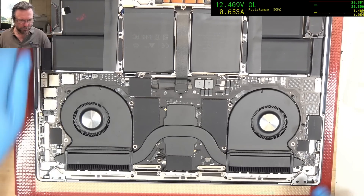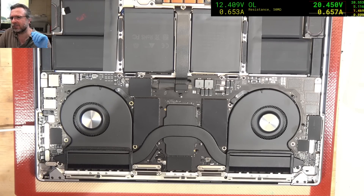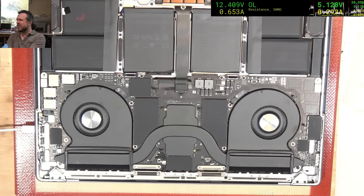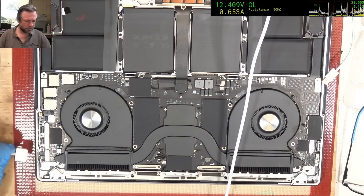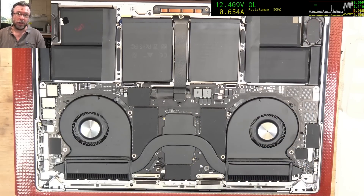Let's see if USB-C gives us anything interesting — 20 volts, reset, 20 volts, reset. We're resetting only at about 1.4 amps. That's interesting. Now we're holding — let's see if this ramps up. It looks like it's trying to get started and then just crashes out. That's USB-C. I'll try a genuine Apple MagSafe now. Current is just haywire — settled down to 400, 300 — we're going the wrong direction. This one's a weird one.